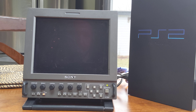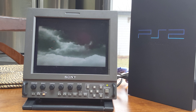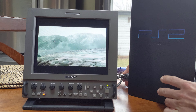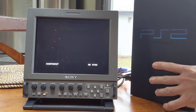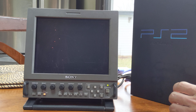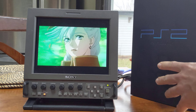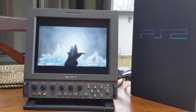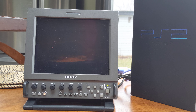What you notice with these monitors is when they fall out of sync, they'll start to jag a little — you can see exactly what happened there, it was moving a little bit. The colors are a little off. It's actually just a loose cable. I cleaned it off with some isopropyl alcohol and put the connections back in, and we should get stability in a second. Sometimes when the cables are loose it'll be a little finicky. On a CRT TV you'll pretty much just lose the signal, whereas on an LCD TV it'll just pick up what it picks up and omit the rest — you might get red, you might get blue, you might be missing green.